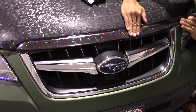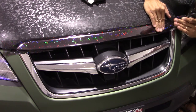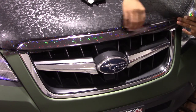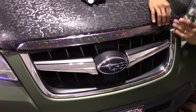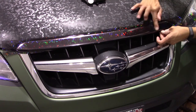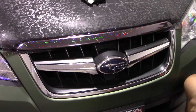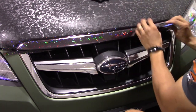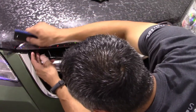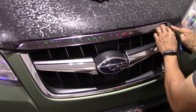Part of the reason I'm doing that stretch is so that with a little bit of heat it will also hug underneath the silver grill piece on the hood. I'm doing the same thing on the other side. I wasn't happy with how it laid down so I pulled it back up and reapplied it. One great thing about this new Bio Pulse Hex Tint is they seem to have changed their adhesive — it's very low tack, so it's easy to pull up.